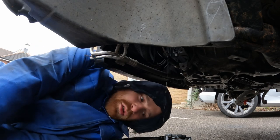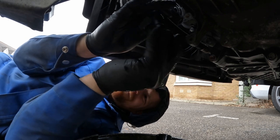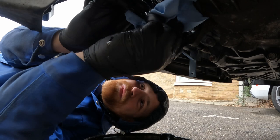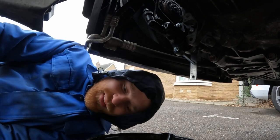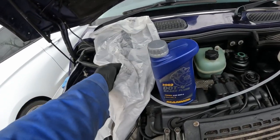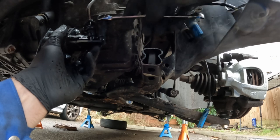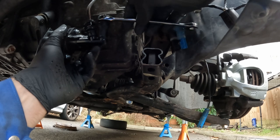Okay. Just going to wipe all that brake fluid off. Okay, that's on. Now we've got to bleed it. So I've got the good old faithful power bleeder hooked back up again, and just a little bit of plastic to make sure I don't get any water in there. So now, if I crack this bleed valve, we should start to get some movement maybe.